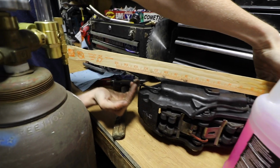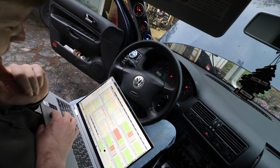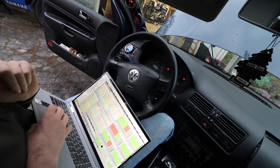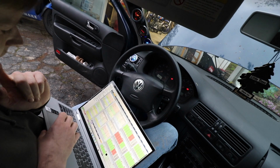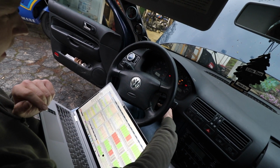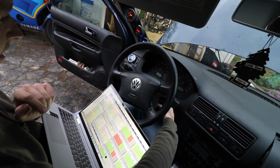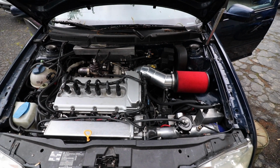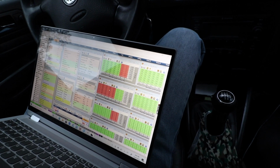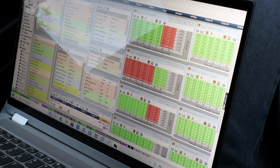All right, so we're busting out with the inches here, like 13. Oh, so the battery voltage is only 11.2. So it is low. What? You gotta charge that thing. That's low. Well, once I start it. If it starts. Oh, this is for the launch. Yeah. Anyway. So right here, I got negative 17.5 degrees timing